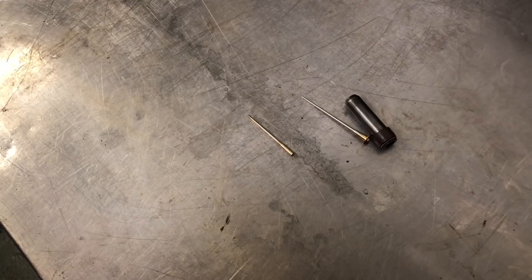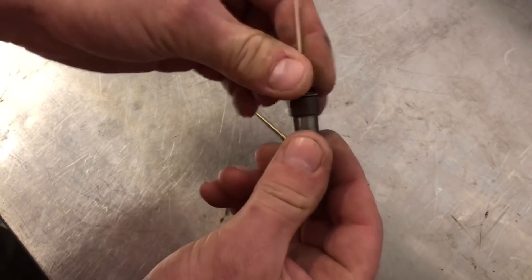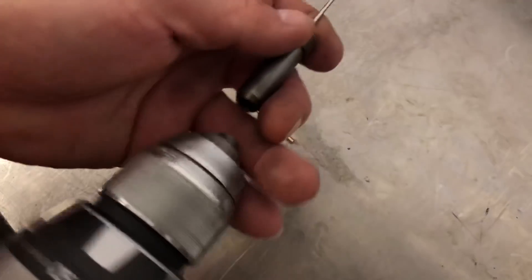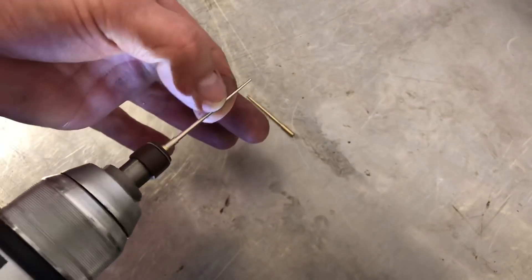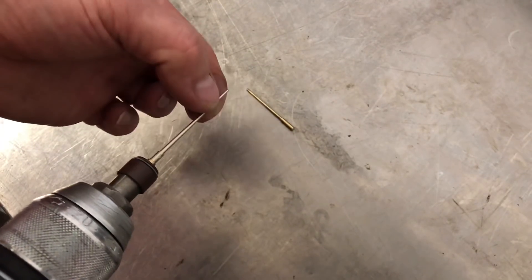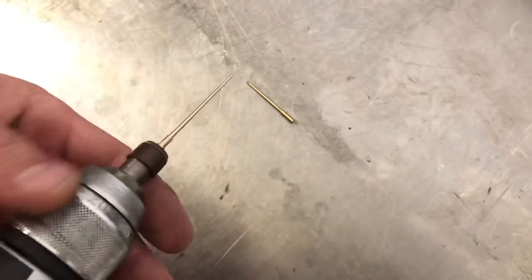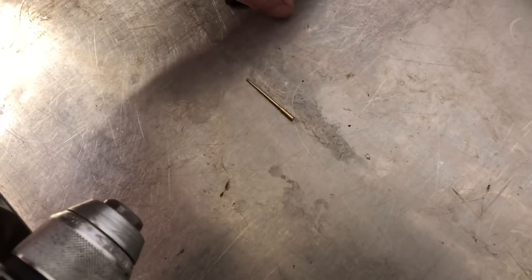We've run the car on the rollers and it's a little bit lean, so we're just going to thin down the needle. If you've got a floating needle, you can use an old valve guide with a seal, just push it in the seal, then run it in a drill like that — hold some tape on there to thin it down. You need to know exactly where to thin it, as this covers top end, mid-range, and around idle. I've been doing it for quite a few years so I'm quite comfortable doing this, and I can check what I've done once I've made an adjustment to the needle.